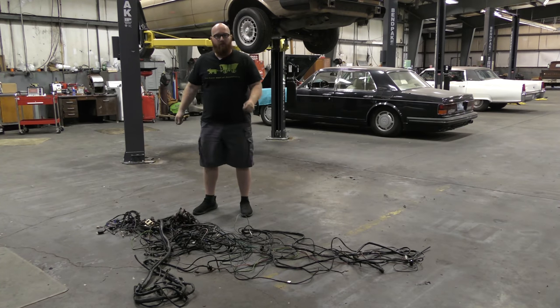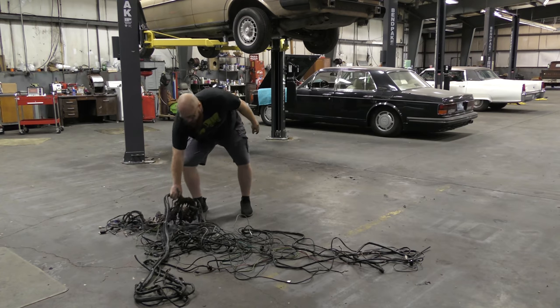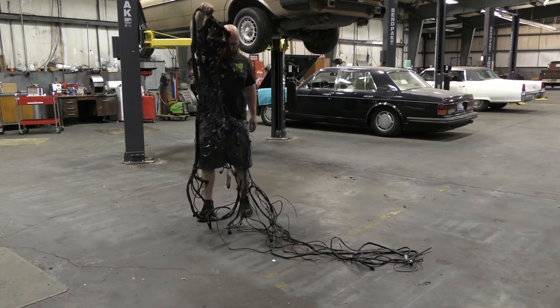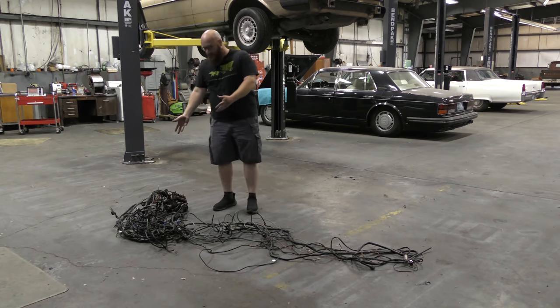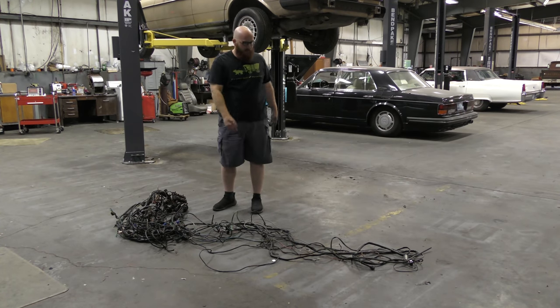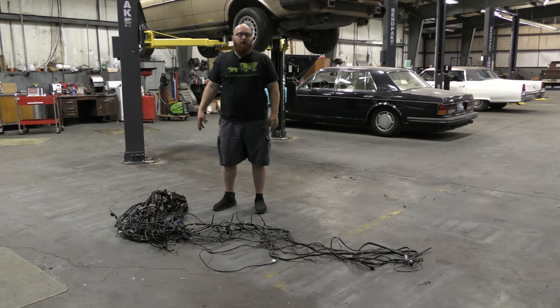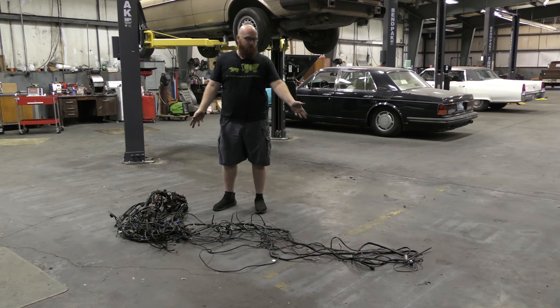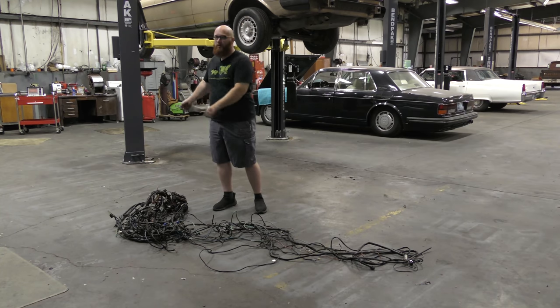Instead of piecemeal fixing a little piece here and a little piece there on the wiring issues — since mice have been all up and down through this whole car chewing wires — we're just going to pull the whole harness. I actually have a complete W123 front-to-back wiring harness. There's tons and tons of wiring; it completely hides my body behind it — it's like a big squid. You have to pull the whole harness out and start feeding the new one through the firewall and the dash. Take a picture before you take it apart so you can see where the red wires went and where the green wires went.